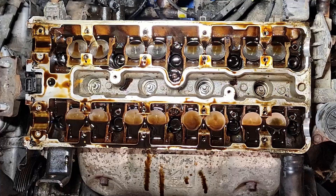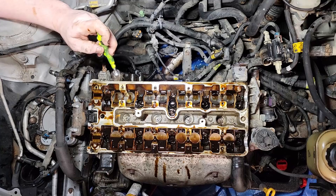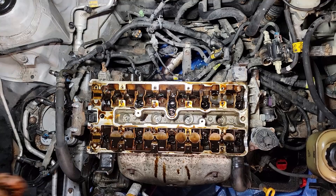As far as the lifters go, you could pop these out with a magnet very easily. If you are keeping your old ones, you need to keep them in order. If you zoom in here, you can see it's like six, seven, eight — maybe you could use that as a number. But I'm not going to do that. I'm just going to pop them out. I bought new ones. That's what you should do too, in my opinion.